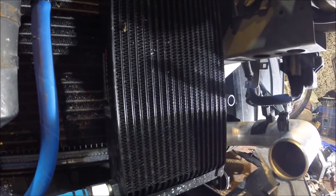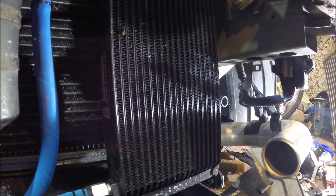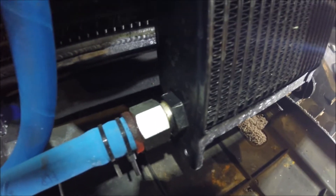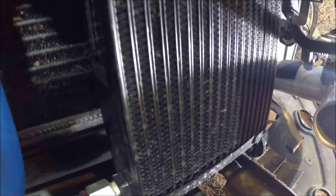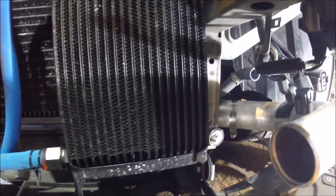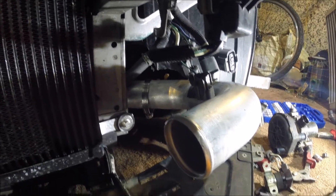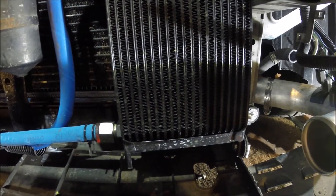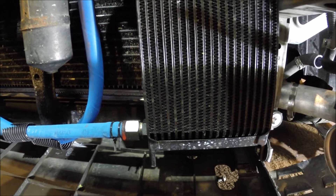As you can see, there's my oil cooler — it's not mounted perfectly but it's been in since November. There's a bit of grime on it and I think it's weeping a tiny bit, but not enough to worry about. You can see I've used the push-fit hoses and they haven't slipped — they still look perfect. I'm impressed with those; I think they're much better than AN fittings. All this intercooler pipework will be going — it's admittedly light — and it'll all be replaced with just the water lines.